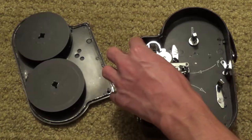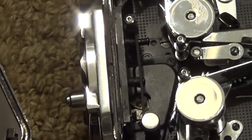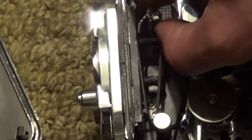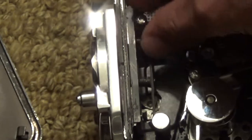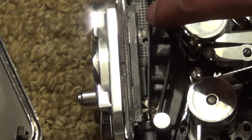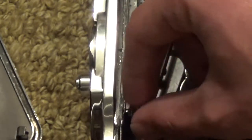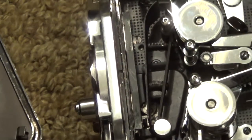There's actually a pressure plate right here — I'm going to zoom in a little bit. This pressure plate is an important part of the camera that you want to clean out, because the film is right here near the pressure plate. What you want to do is pull up on this pin and move the pressure plate to the right. You can then clean out the inside of the camera with some compressed air. You can even unscrew the pressure plate — there's a little screw right here — and actually take out the entire pressure plate.